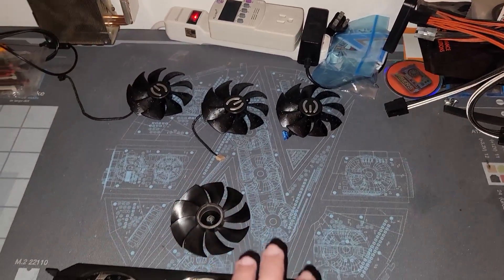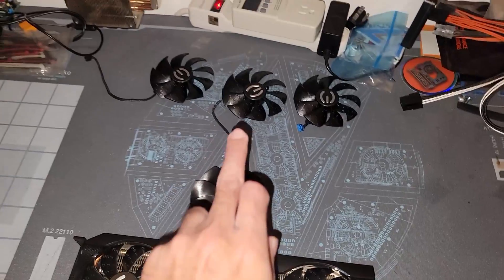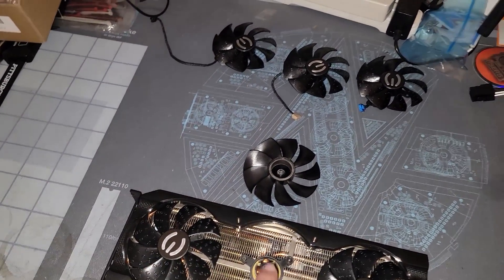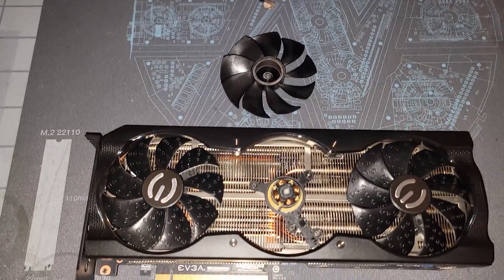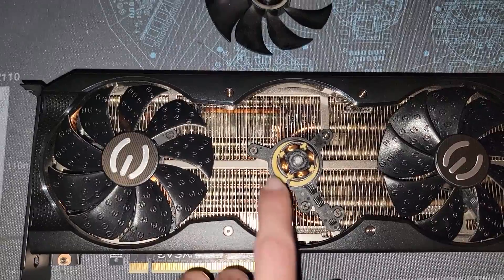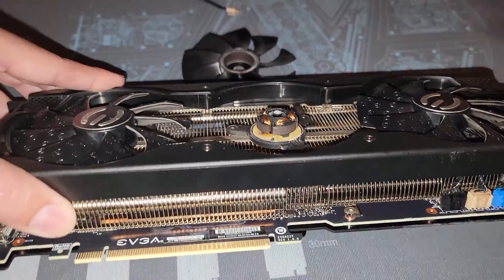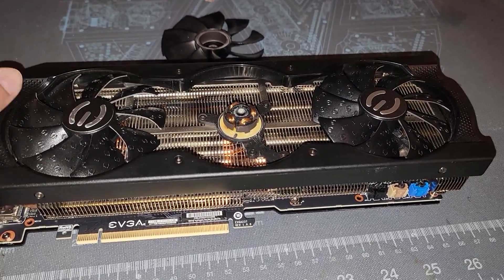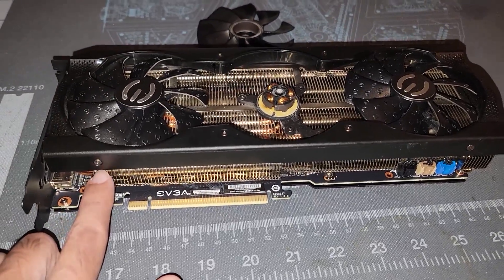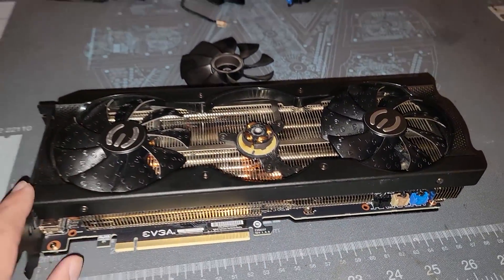Each of these fans goes to a specific position because of how short the wire run is, so they can't be swapped around freely. Check out GPUFanReplacement.com — link in the description below. We're going to start tearing down this GPU. There are four screws for each fan, but I'm going to see if we can attack this from the top without a full teardown, since I have fresh thermal paste and thermal pads on here and I'd rather not mess that up. We'll switch to the GoPro and see if we can get to the fan area and wiring from the top — if not, we'll tear it all the way down.